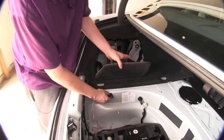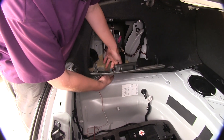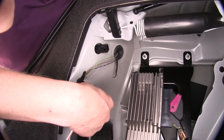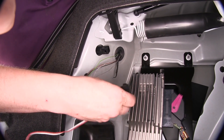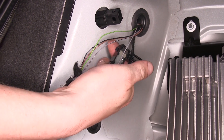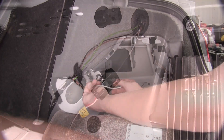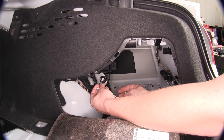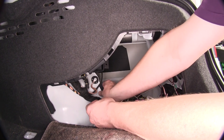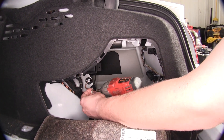Once we get over to the other side, we're going to open up the panel over here. Slide this wire underneath this carpeting, then bring it up and separate out the wires on this side as well. This one's going to clip on the gray and white wire. We'll now take our white wire here — this is our ground wire. We're going to use the self-tapping screw that comes in the kit and run it through the paneling right here. You'll do this with a quarter inch socket.